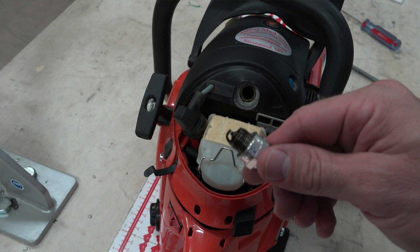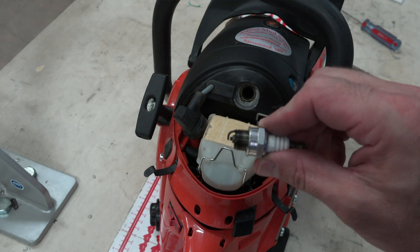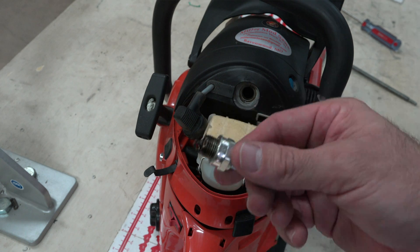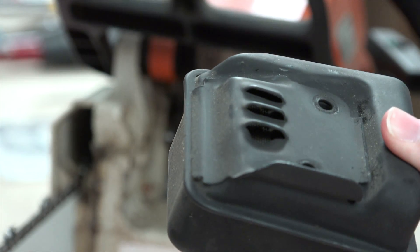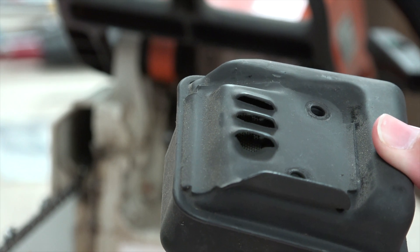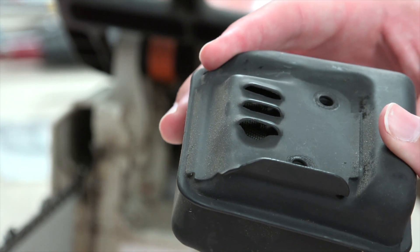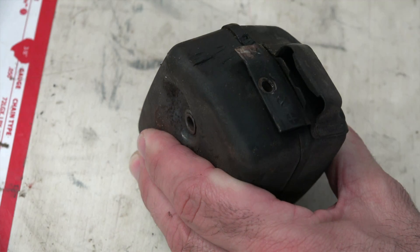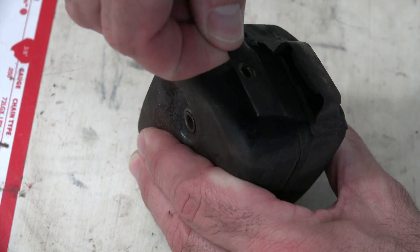One of the other things you're going to do is check for spark. If spark is present, check your spark plug to make sure you have the proper plug installed. What is the condition of the plug — does it need to be replaced? Also check the spark arrester screen, located on the muffler. If this is restricted, the engine may not run at all or only idle but won't rev up. Some can be cleaned, but replacing would be the preferred choice.